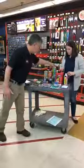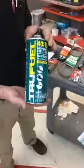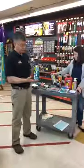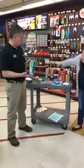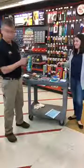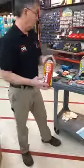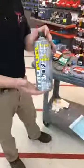If you can't get non-ethanol gas, there's a product — gasoline in a quart bottle. It's pre-mixed, there's no ethanol in it, it's a very refined grade of gasoline. Your machines run incredibly well with this. Our landscapers buy this by the gallon. If your machine calls for a 40 to 1 mix and it's a 2-cycle, that's available. If your machine requires a 50 to 1 mix, that's available. There's even one for a 4-cycle, for your regular lawnmower. It comes in quarts and in gallons.